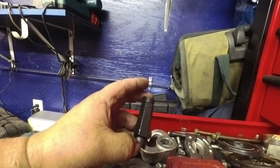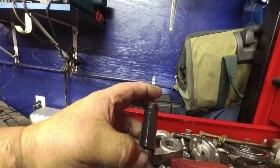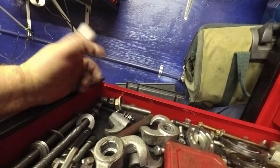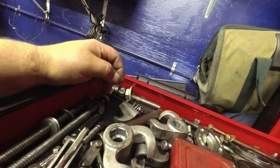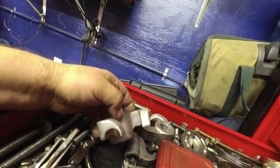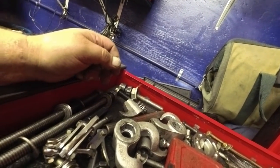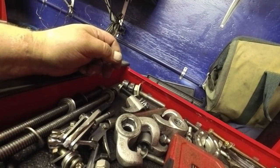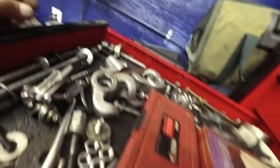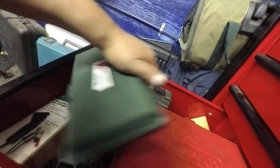These are for spreading manifolds out on Chevrolets — I guess you can use them on anything, but I have had occasions where I could use these on transmissions as well and they did work. This here was a spring compressor for struts, and I took it apart and use it for putting in the 140s, 240s, and 150s — the planetary in the case for the Toyotas.